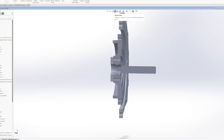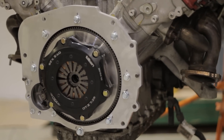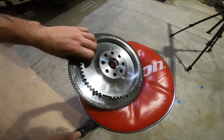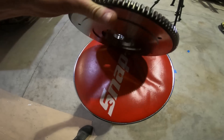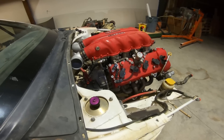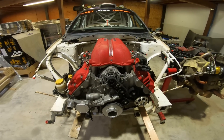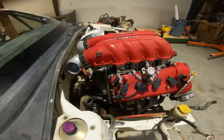That's basically how I went about getting the flywheel designed and making it all connect, be within spec, and be able to use a hydraulic release bearing so I didn't have to do a whole lot of other modifications. This is the final result with the clutch mounted onto it and sitting in the engine. If you've seen it on Instagram, I was able to rotate the crankshaft with a breaker bar and it made the wheels turn, then push in the clutch and it stops rotating — so it looks like that all works out pretty good. I'm pretty excited to see it come together. If you want to see the walk-around, I'm going to make episode two a general walk-around of the car and what we have in store for the next steps. Thanks for watching, and if you have any questions feel free to comment below — thanks!